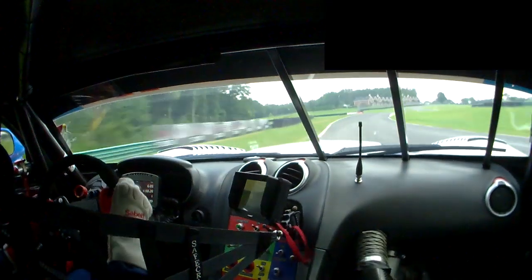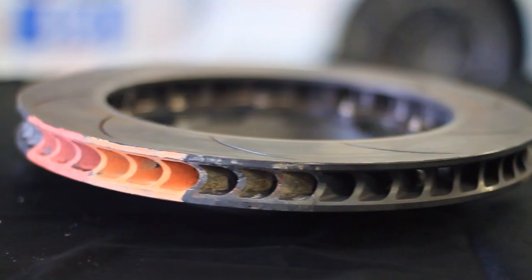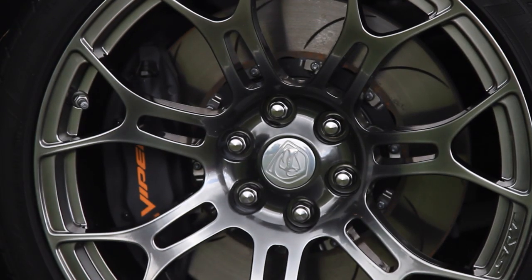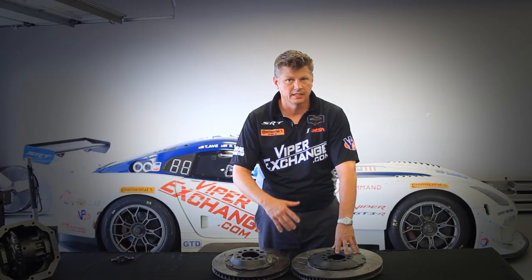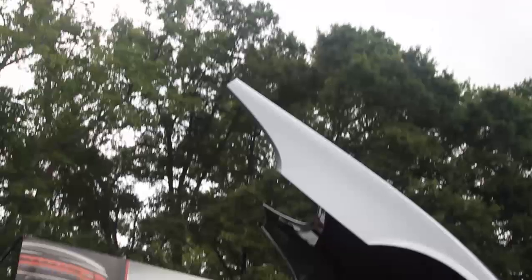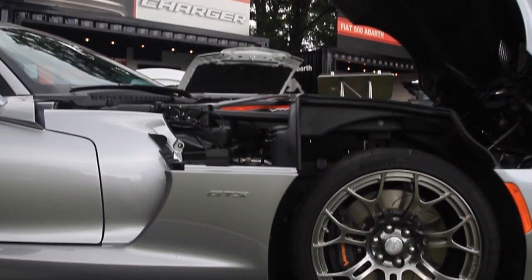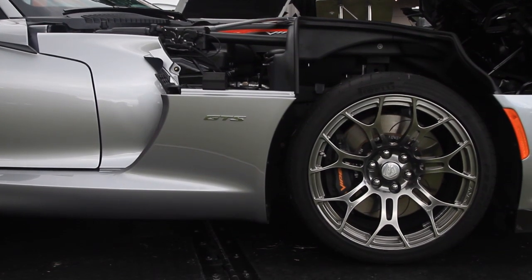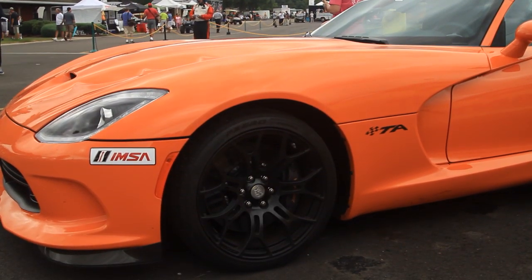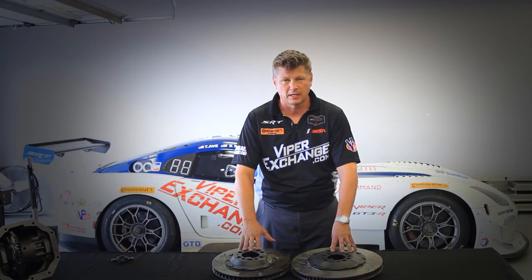On the street car, the system needs to be designed for all types of uses. You've got different sized wheels and the systems have to fit. The problems you're going to encounter with a street car brake package on track cars or performance driving at HPDE — anything you're doing at a continuous track event where there's long periods of braking — is the fact that you'll have warpage problems. The other thing is you're going to put so much heat into the stock braking system that you'll actually get more brake fade. You'll get less braking performance out of a street car package than out of the race package we've developed.